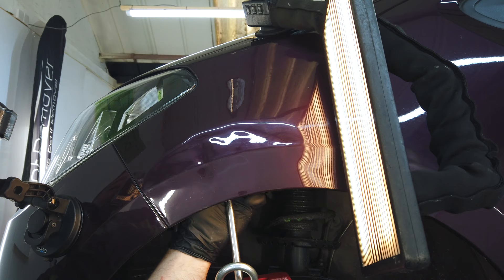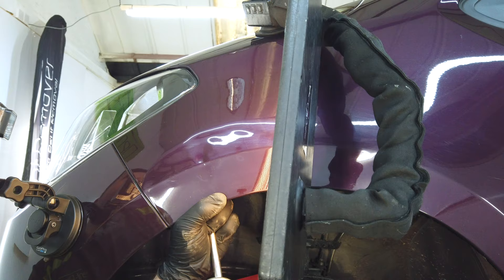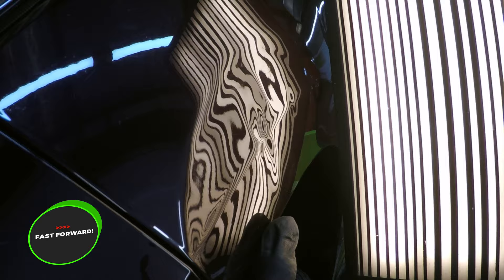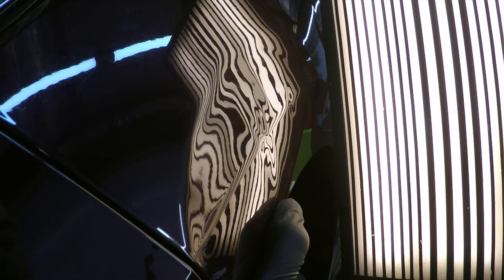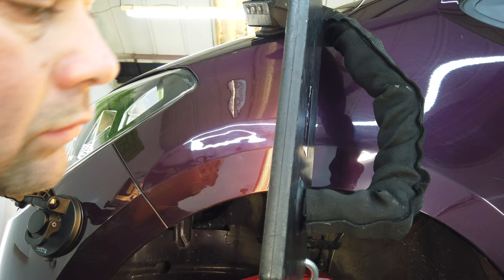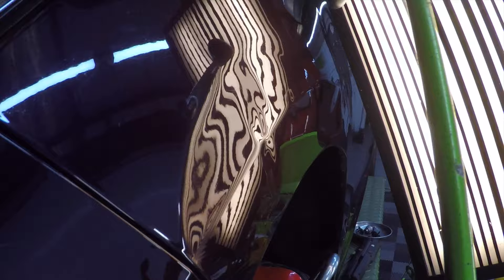Changing positions with my light board, I'm also working behind the GoPro so you can see all the pushes I'm making to gradually repair this dent. Because I'm using a large rubber ball on the end of my bar I can give the damaged area some good solid pushes without any risk of cracking the paint. You can see that I'm continuing to lift up the damage underneath the crown, carefully working backwards and forwards. Because this crown is prominent it's going to take some time to gradually smooth it out.